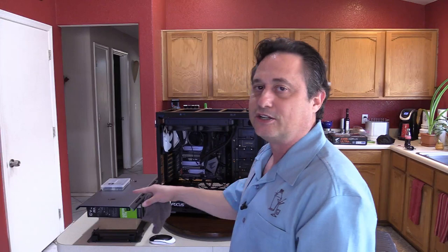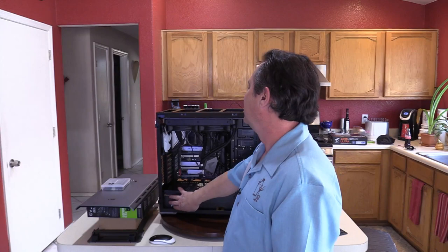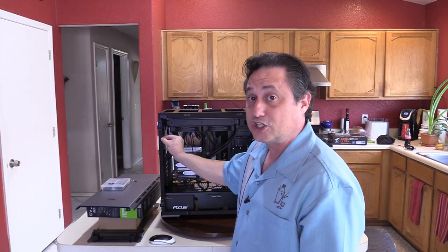It's not likely to happen. It's more likely to happen if you're opening up a power supply, getting into where you're not supposed to get in. But there's no harm in just leaving it unplugged. Then the possibility is zero. Instead of unlikely, it's just not possible. That's why that anti-static strap, and I can't stress this enough, doesn't plug into the wall. They don't want you plugged into the wall. That's incredibly dangerous. If the computer's plugged into the wall and your anti-static strap is connected to the computer, you're still plugged into the wall.